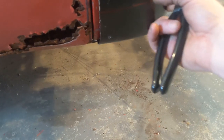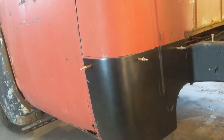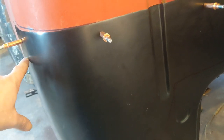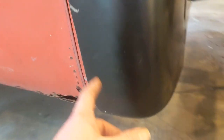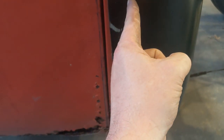The bottom will get pulled in just a tad. It's just because the other piece is still there, it's got it pushing out just a tad. So what I'll probably do is, I know I've been back and forth on which way I was going to do it, but I'm probably going to take this back down, come in just below my holes for my Clecos, and cut the majority of all of the old out. And then I'll come over here, come in here-ish or so, and make me a cut and cut all that loose, get all that out of the way.